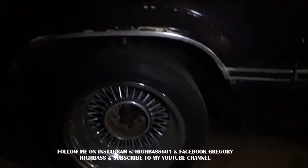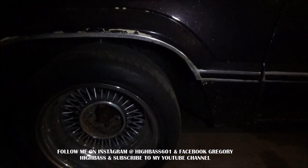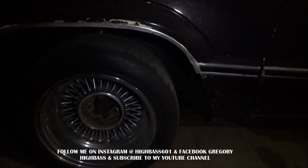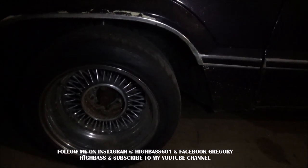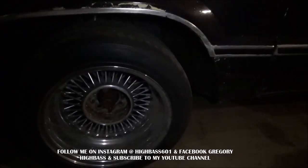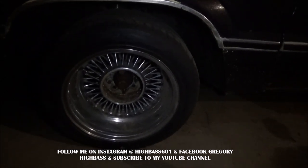So how we gonna do this? We're gonna actually change the rotors out and the bearings, and the race in the rotor. So, an 86 Grand Marquis and a Lincoln Town Car, what I looked up and what I had a shop look up for me, these cars carry the same front rotor. So I'm gonna be changing out the rotor on the front to fit these two other wheels that go on the front.